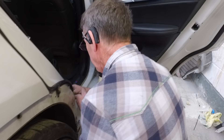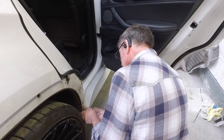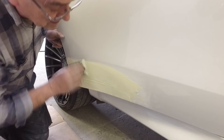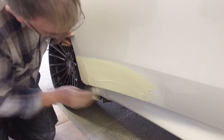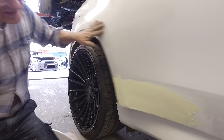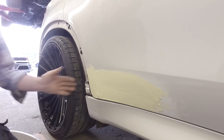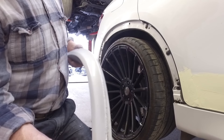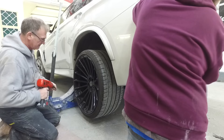So what are you up to, Dave? I'm working, doing the job. I'm just putting a smoothing coat of filler over the repaired area just so it makes it all nice and flat - we can rub it off and it'll be all smooth. We'll just check the gap is okay. As you can see it now lines up with the sill. The rubber will then go back there. And the next bit is a little repair on the end of the fiberglass arch - you can see it's cracked so we've got some resin in there to reshape and refit it.